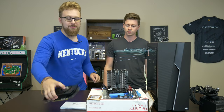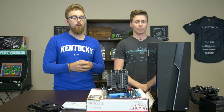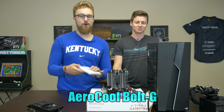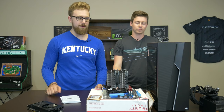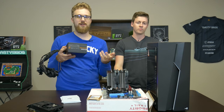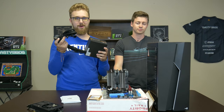To make this system possible, we're gonna be throwing a 1060 3GB in it, which is actually a decent budget option right now on eBay. You could also go with something like an RX 570 or 580 if you want — it'll be more than compatible with a system like this. We're also putting this inside a case from our friends over at AeroCool — this is the Bolt G, which has a bolt look on the front and RGB lighting. We're also adding an RGB strip we got off eBay. This makes it a $325 gaming system. To power the system we have an EVGA 500 BR — a 500-watt 80 Plus Bronze power supply that's around $30 to $40 on Amazon, which is more than enough to enable some overclocks and power the rest of the system.